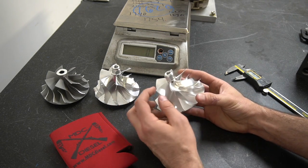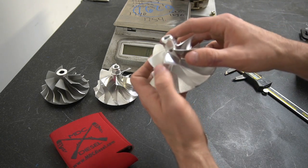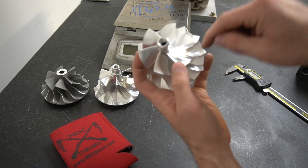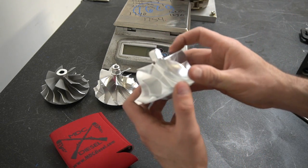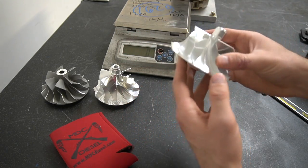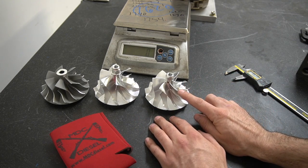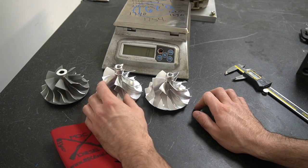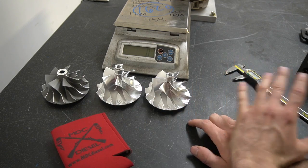This wheel is ballpoint milled — milled basically by the point of a tiny pin, which makes these little tiny grooves running all the way across it so it can make really fine changes. If you can see the compound curvature of this wheel, it's got a whole wavy texture to it. It moves a lot more air — we've actually run them side by side and we're seeing almost 20% gains with these as far as power, versus the standard billet wheel which is already seeing 10 to 15% gains over the cast wheel. So this wheel is going to outperform the cast setup by a large margin.